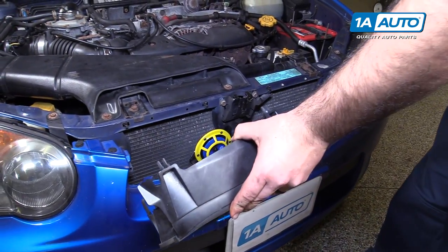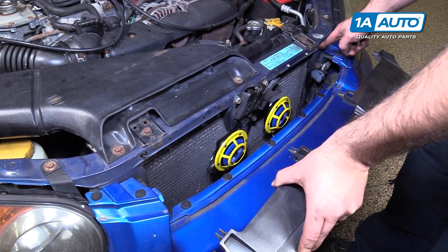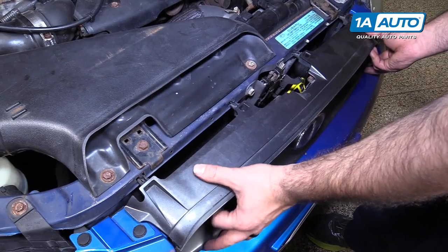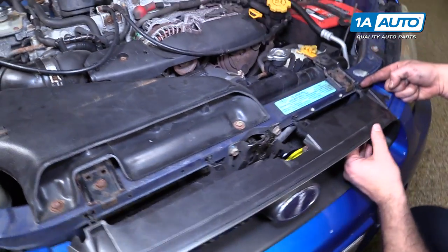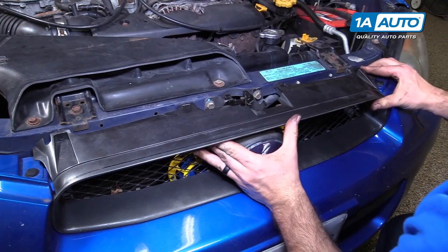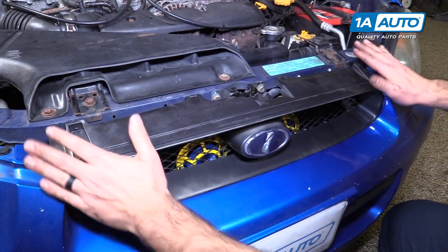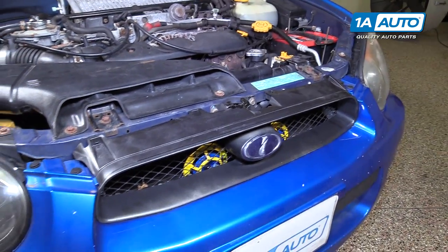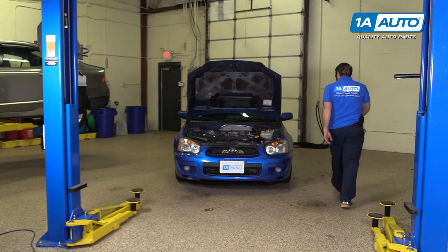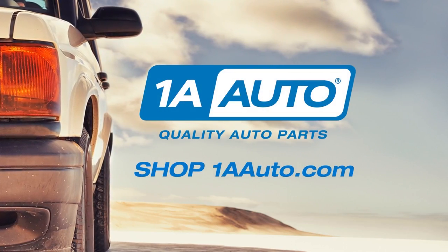I'll put our grille back in. These locking parts go into the lower pieces right here, and then these will fit over the clips that are in the radiator support. I'll start with the bottom ones — you might have to line these up at the same time. Simply push in, just like that, and now they're locked in place. Now we're going to test the sound from 10 feet away. Thanks for watching — visit us at 1AAuto.com for quality auto parts, fast and free shipping, and the best customer service in the industry.